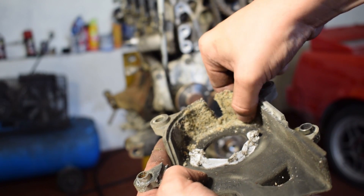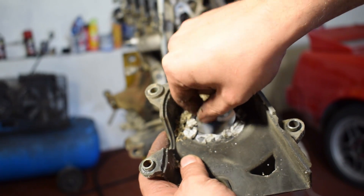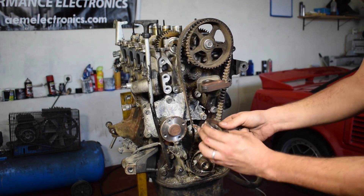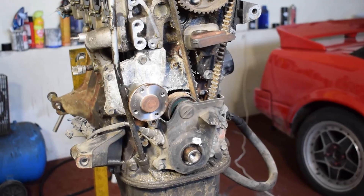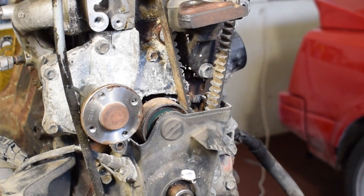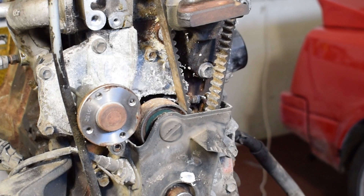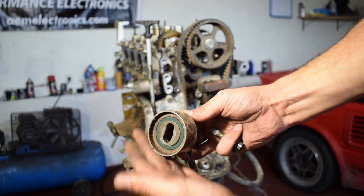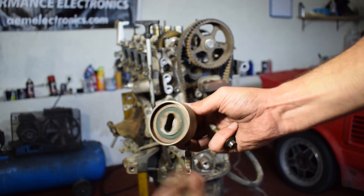There's a nice little row of bug cocoons neatly stacked next to each other under the timing belt covers — and a lot of disgusting sand. Just like the 4AGE, the 4AFE relies on a spring for belt tensioning. This spring pulls on the tensioner; on engines with a lot of miles the spring can get tired and provide insufficient tensioning, which can cause the belt to skip a tooth — so many people prefer to manually tension the belt on these engines. Interestingly, although completely rusted on the outside, the belt idler pulley seems to be in great condition and doesn't make any weird noises when rotated.